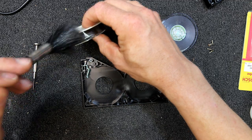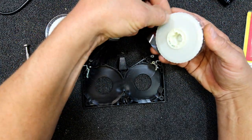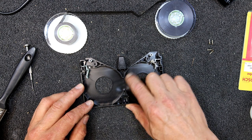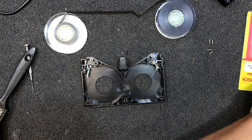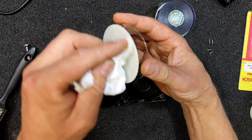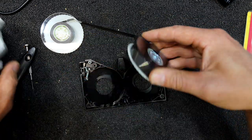It'll be fine — it's easy enough to clean the video heads if anything does clog them up, but I'd prefer to avoid it if possible. The underside has got a bit of stuff on it — I might just wipe that off, as that could cause friction. You can see where it looks like it has been rotated; I may have already played this tape briefly. I'll get a bit of paper towel and clean up underneath where the tape spools sit, because you don't want any friction there.